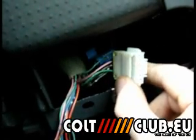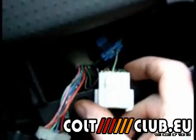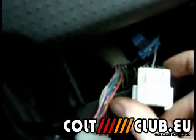And obviously when you turn the engine off, you want that signal to go. On my car, if you're holding it right, it's the third wire in, which is a green and white.